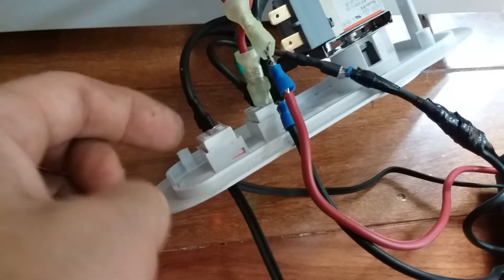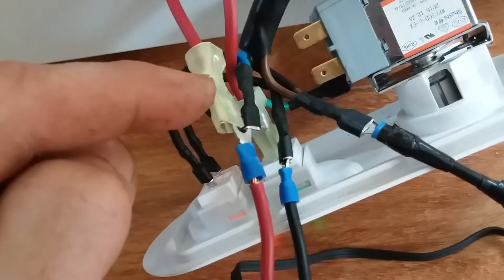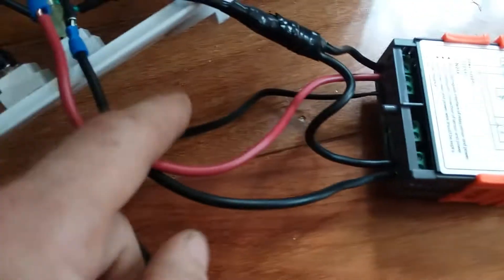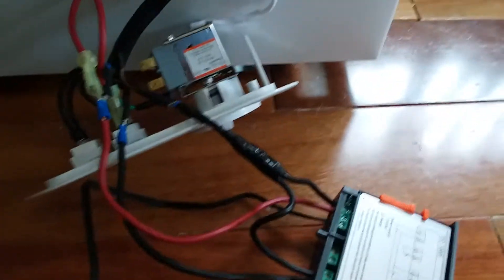You can see my lights still work, and that's because there is already power on the two bottoms of each light and two neutrals coming out the top of each light. So you can just take the neutral from the top of the light — which is what I did. I'm temporarily just stealing that neutral. I plugged in a red wire, brought it here, plugged it in twice, which allows my light to still work and also lets me steal the neutral and bring it over to terminal number two.